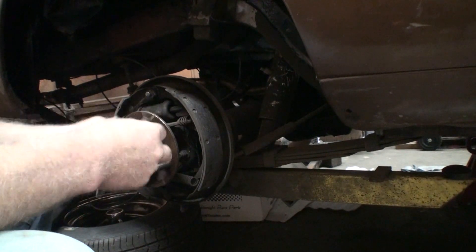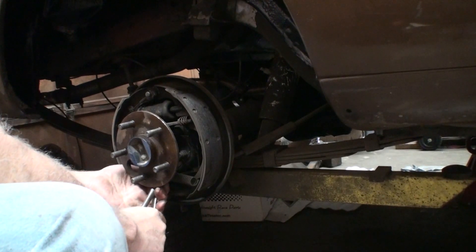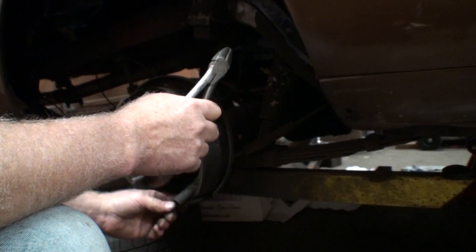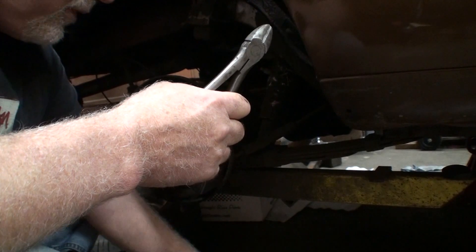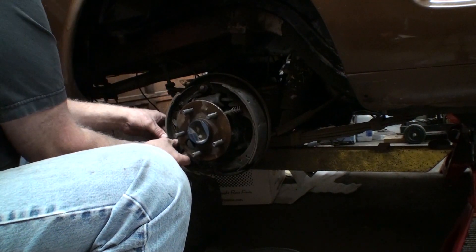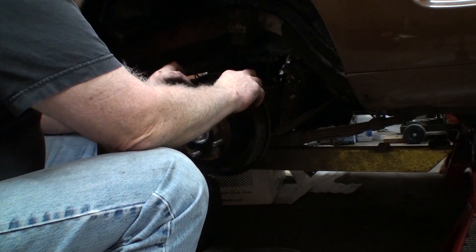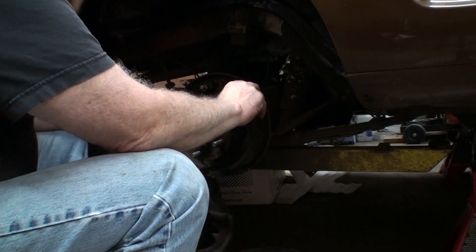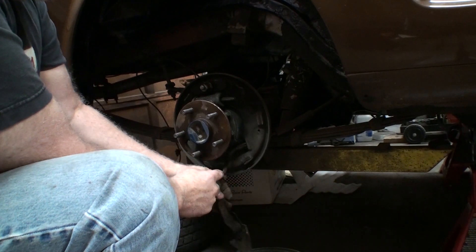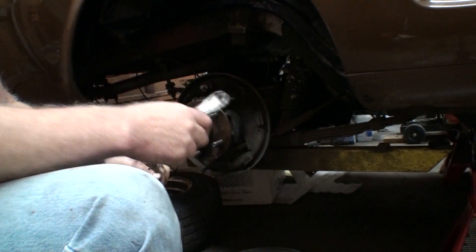Green on the front, yellow on the back. I have to unhook this emergency brake, which I have hooked up in the front, which may make it difficult back here. Put all these tools in here — I should probably have a container for all of this stuff. So here's the deal with the emergency brake: you have to pull this spring back so that you can get the slug off the shoe. I use my wire cutters for this, just like that. Makes it super easy.